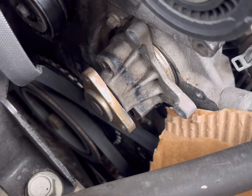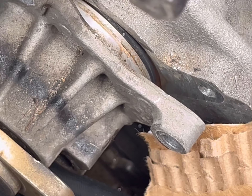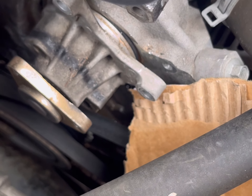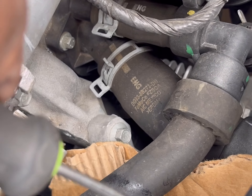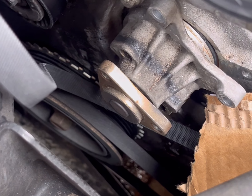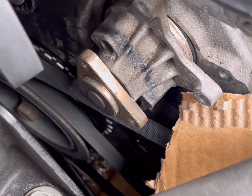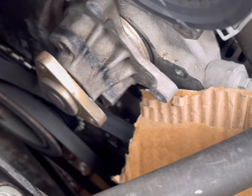The water pump is now separated — the seal is right there around the edge. To let it drain, just pull the water pump back a little bit. You might need a flathead screwdriver to pry under the edges where the fasteners go, but not too far in — you don't want to mess up the seal or the cast on the engine. Let it drain out, and once that's good, go ahead and put the new one on.